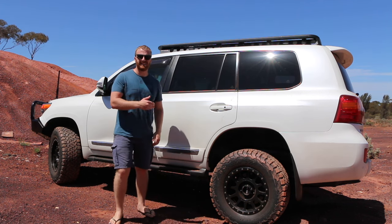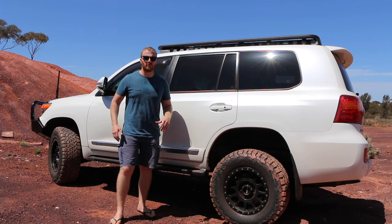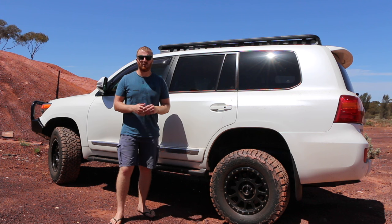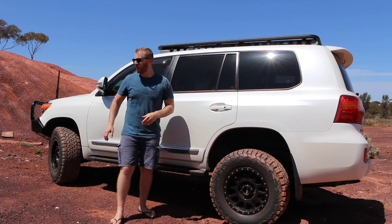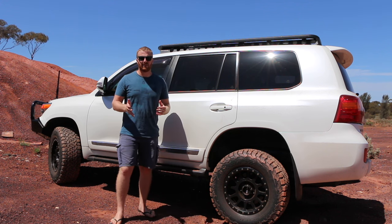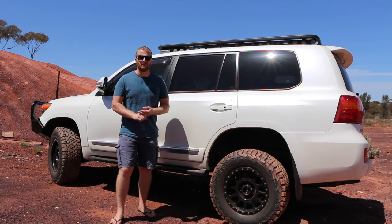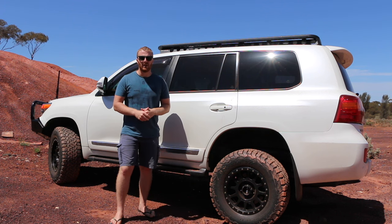The first thing we're going to talk about is the centre differential. These cars are an all-wheel drive all the time. When driving on-road, power is being sent to both axles, however that power is not being evenly split. Just like a differential on an axle, the power will be sent to the axle with the least resistance. When accelerating on high traction surfaces like bitumen, most of your power is going to be sent to the front axle. When we're off-road we want that power to be split through the transfer case evenly 50-50 to either axle. There's a switch by the driver's right knee which you can activate to lock that centre diff and make sure the power is split between the axles evenly, giving as much traction around the car as possible.